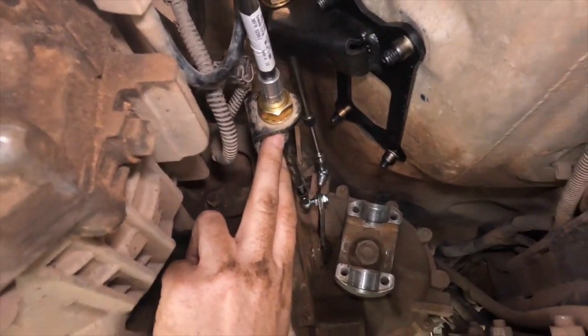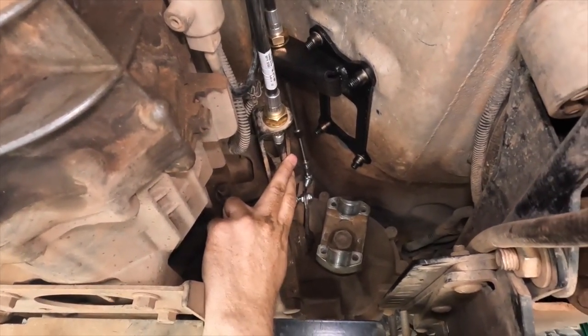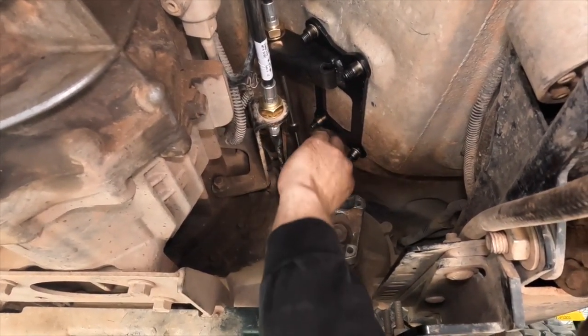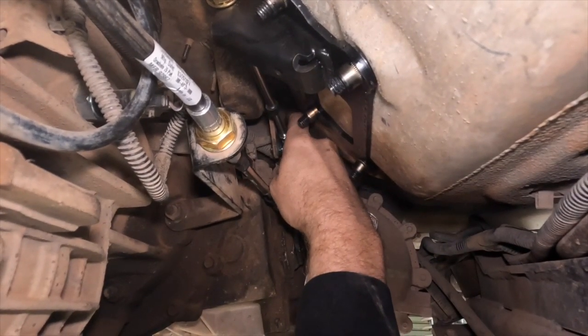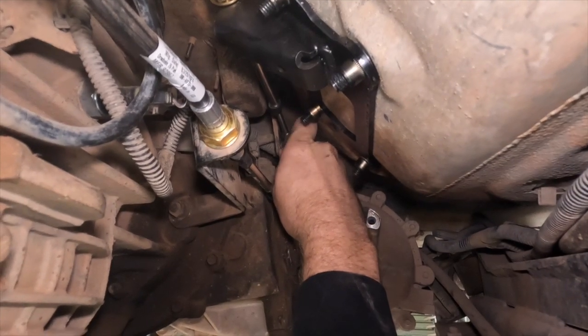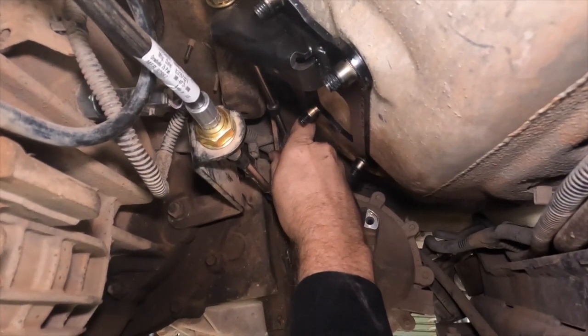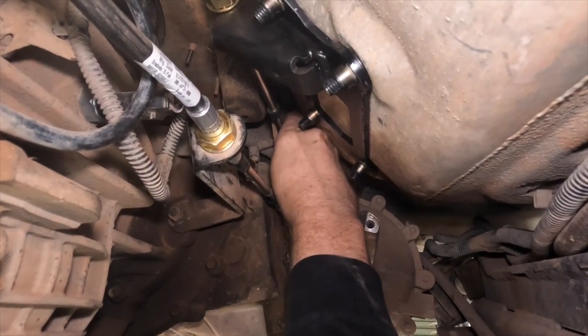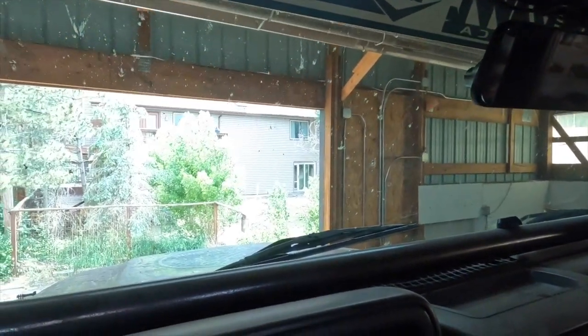Okay. Now, I've made my housing as short as I can, so I need to make my cable longer, so I'm threading this out. Oh, I see. I think you're through. Yeah, you're through. So is it a washer and a nut now, as well as that jam nut? Yes, so setting the jam nut just to kind of hold things in the right spot. Back up a bit. While she's in the air, because I have to work on moving the lever.